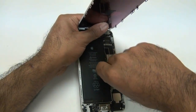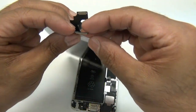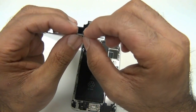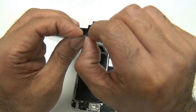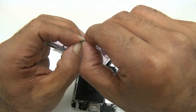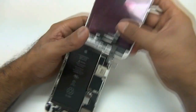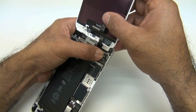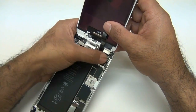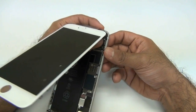What you want to do to make sure it works is disconnect the battery, and do this every time you install a new display on your phone. You'll notice the flex cable got bent a little bit when I was plugging it left to right — that can happen just because it is such a long flex cable. Use the top of your thumbnail, grab the two edges, and gently bend it so it's straight. You don't want any curvature or any non-perfect looking flex cable. Blow out any dust that could be there, and make sure your battery is disconnected. Now plug it in dead center — not left to right or right to left, but dead center — making sure it's perfectly lined up. If you don't feel even clicks on both connectors, redo it because it's not going to work properly.